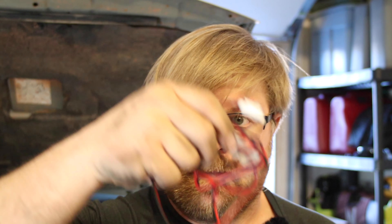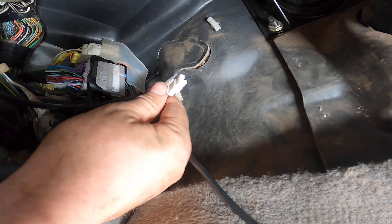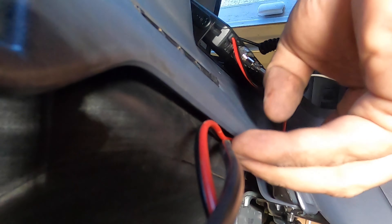We're gonna take this end — it connects to the radio — and shove it through the firewall along with the patch cable for the antenna mount. Both ends get pushed through the firewall and caught on the other side. Feed it through and pull it out until you can get the wires to where you want to mount the radio, making sure they're routed so they won't be in the way — especially important here since loose wires could fall down into the driver's feet while driving.